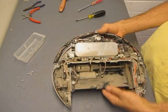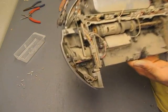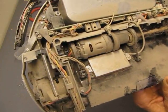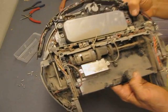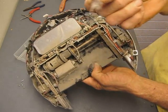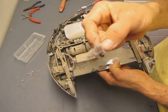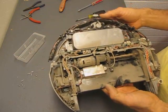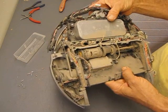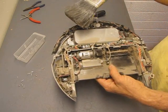It's pretty common to open these up and find all kinds of crud inside. This one's covered with mostly lots of dust — as you can see, it looks like it's been roving around on the moon, basically someone's house. I have taken these apart and found virtually an entire carpet in here. It's not a good idea to be breathing this, so you might want to take it outside and blast it all off with some compressed air. If you don't have that, a simple paintbrush does a pretty good job brushing things out of the way.